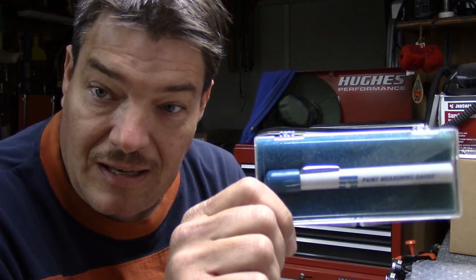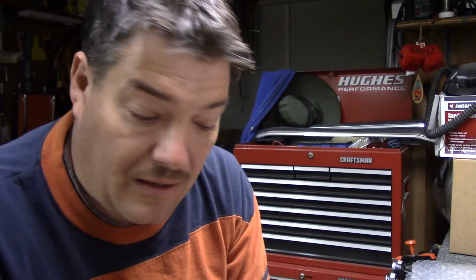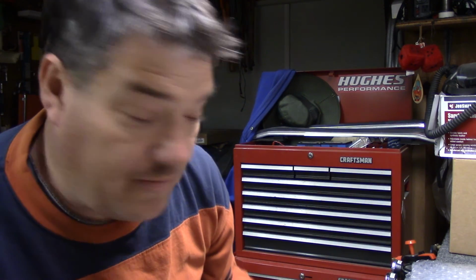It was about 2 mils difference. So that's an interesting tool, and I'd like to thank Roger for sharing that on YouTube. The part that I'm looking forward to using it is on primer and sanding, especially on clear and sanding clear. I'd like to be able to start with my baseline and know how many mils is on the panel, and then when I get finished, know how many mils, and then I'll be able to determine how many mils of clear is still left on the panel for protection. I think that's pretty neat. So Roger, I appreciate you sharing that on your videos.